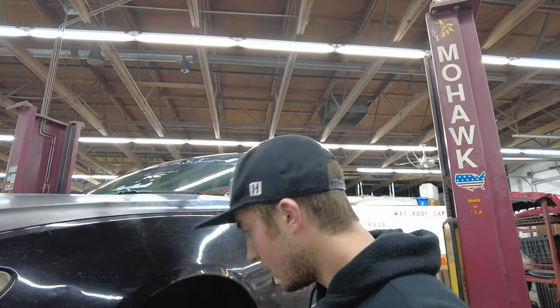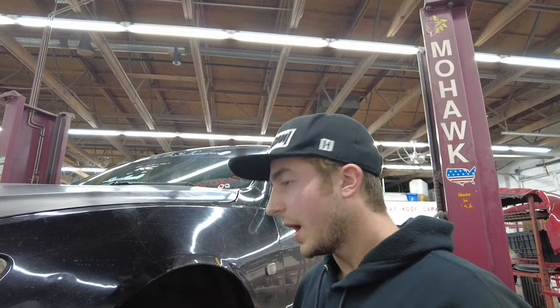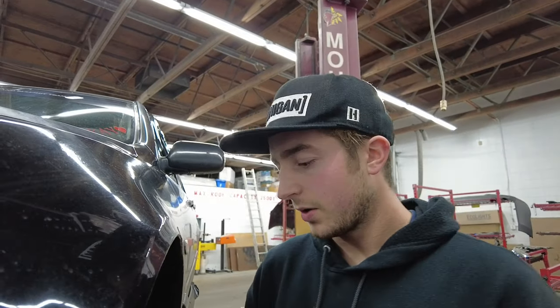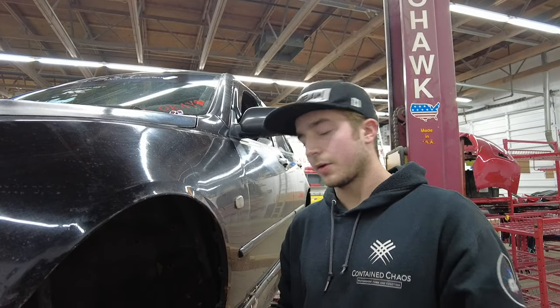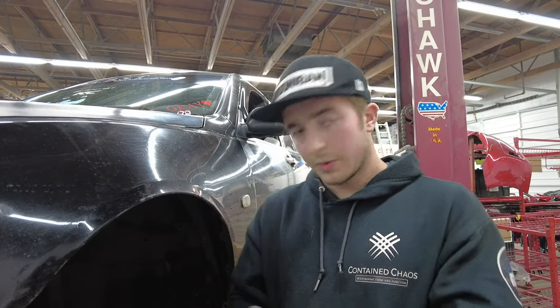So you're going to set your ride height to wherever you want it. And then ideally, I don't have caster arms that are adjustable. I know that you could figure out how to adjust them. There's probably plenty of ways, or just by counting the threads of how much caster you like. We don't have adjustable caster arms right now. So you do caster, camber, toe, because especially on this style suspension, when you raise or lift the car, it all works off each other, right?